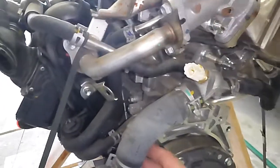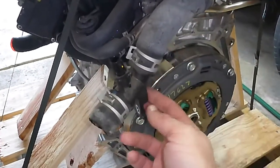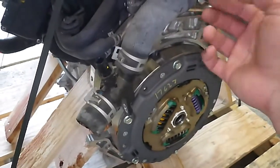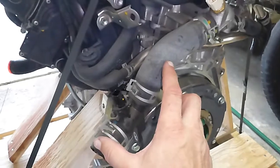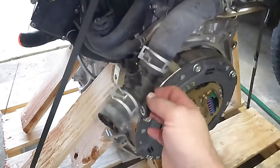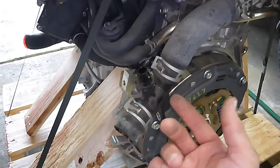We're going to keep this configuration and accommodate this radiator hose. If you don't have this section to connect to your lower radiator hose on the driver side, you can buy it — it's about $35, roughly $15 for each piece plus tax. If you don't have that, you can use the short stubby hose that comes off the 2012 and shoot it down and grab it with an 8-inch, 1-inch galvanized pipe from Home Depot. You can also set it up like this — Toyota calls this an 'A pipe.' There's a little sensor there; leave it in because it seals the hole.